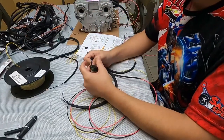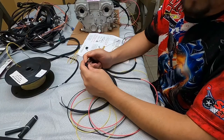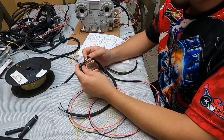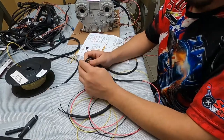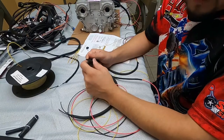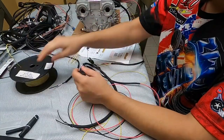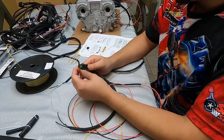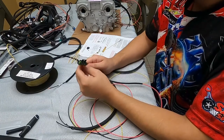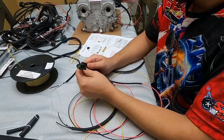I called Halltech, called a couple of local race shops, and talked to a couple of racers about how they connected the coils, what wire size they used, and where they connected them. I took everybody's perspective, took the most common approaches, and put my own little twist on it. I do have a new roll of yellow wire here because the wire I used is 20 gauge, but I'm going to drop it to 16 gauge for a little more consistency in terms of the electrical current going through it.